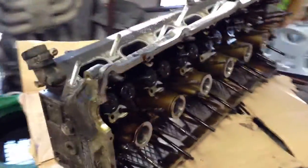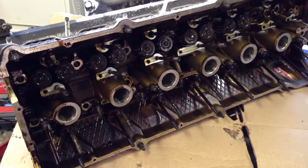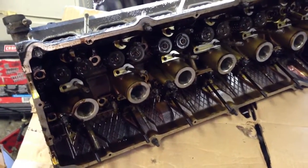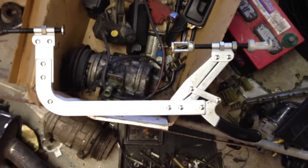I'm actually stripping this one of all the valves to ship it, but figured while I'm doing it — I'm about halfway done already — I'd show you guys at least a couple of tricks, because sometimes these are a little bit different than, say, Toyota cylinder heads. To start, you're going to need an overhead cam spring compressor, which looks probably a lot like that.